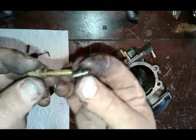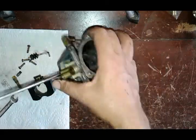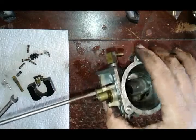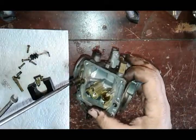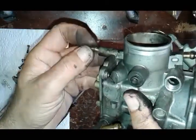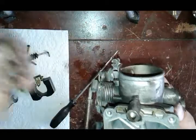Next I've got a screwdriver that I filed down because you really don't want to strip this jet — it's deep inside, so make sure you've got a good screwdriver to get this jet out. It just comes out. Next I'll take my air and gas mixture screw out. If you have a stock carburetor that nobody ever messed with, right in this place there would be an aluminum plug and you wouldn't be able to access this screw. I do recommend, if you want your bike to run a little bit better even if it's bone stock, taking the plug out with a little drill bit to access this screw.